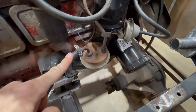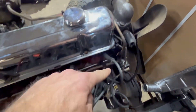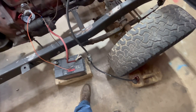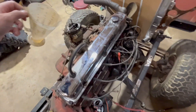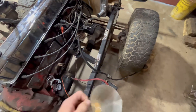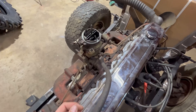On the fuel side, I love these simple old vehicles — there's no return line, just a suction and a discharge. There's a hard steel line going into the carburetor and then a hose into a fuel can with a filter on it. If you're starting up an engine like this, pour a little clean fuel into a small can — that'll get it to crank over faster and pull fuel up there a lot faster than if you're just cranking on the battery.